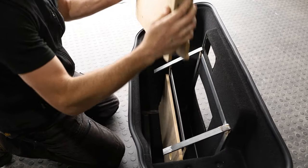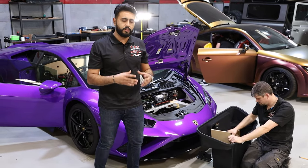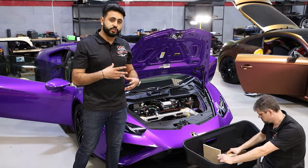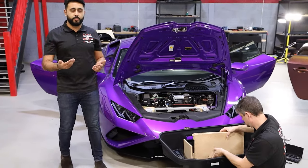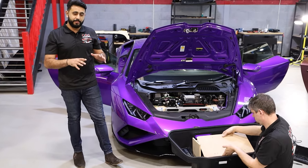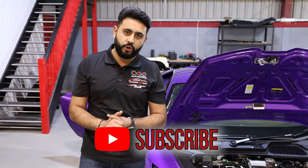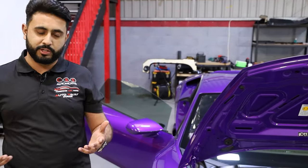It is going to take up literally the whole tub, not because of size, but mainly because of airflow inside there. So we're having to build and construct panel work to allow it to sit in there, but also allow for maximum airflow to keep everything very cool, because these are class A amplification. They get very, very hot, so it's very important that this area stays as cool as possible.